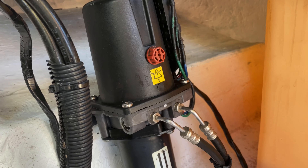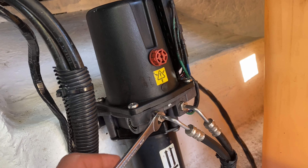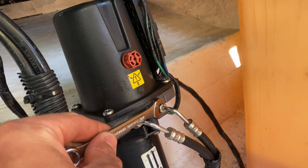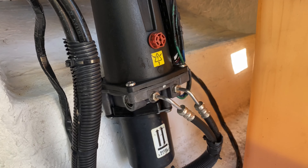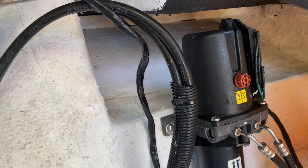If you're using just regular box wrenches on these 7/16s, you're going to damage the flare, especially when you go to torque them down. You can see on this one over here, they've kind of slipped off a little bit and that's damaged that flare. Brand new flares — do your due diligence and get some flare wrenches. It would make everybody happy.